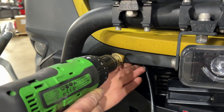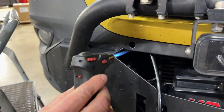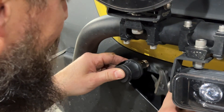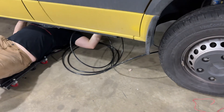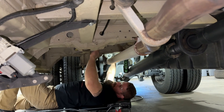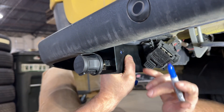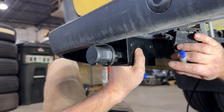It's time now to get the front air chuck set up. I did not want to drill into the bumper itself - I didn't think that was the right solution - so we're putting it straight into the bumper skin. There's going to be one on the front and one on the back side of the van. In order for the air chuck on the rear of the van to function, we need to run an air line underneath the van, tuck it in nicely in a safe spot, and hook it up to the spot on the rear bumper. As it turns out, the bracket that comes with the air compressor kit fits nearly perfectly on the rear step that came equipped on my van.